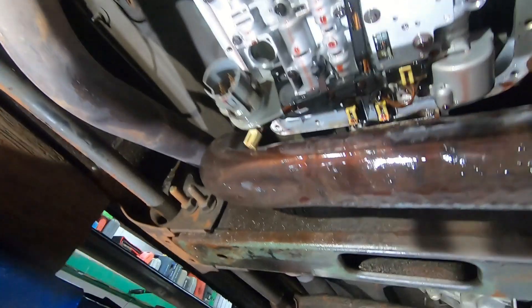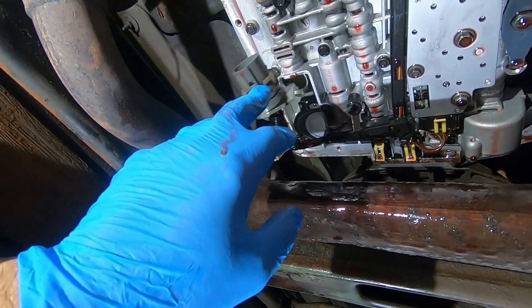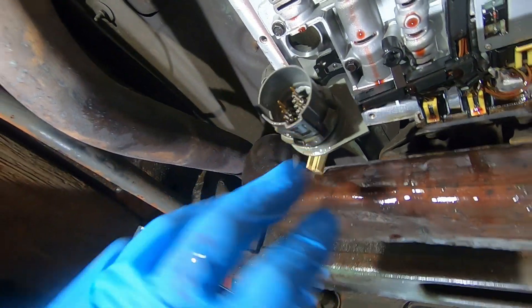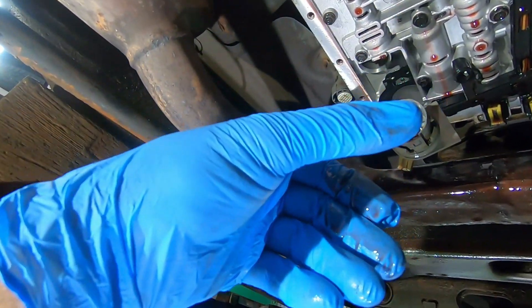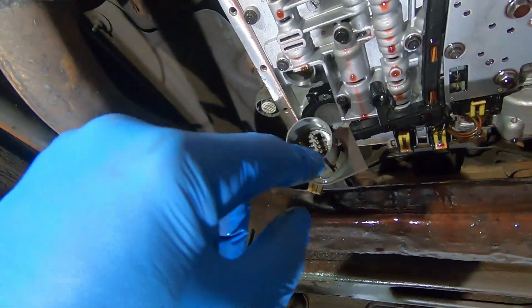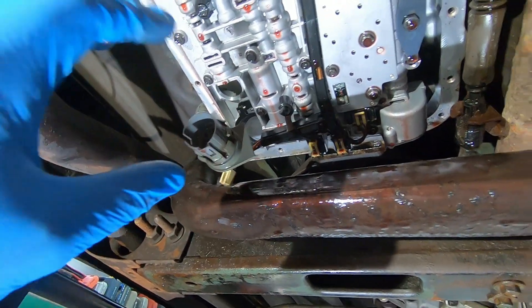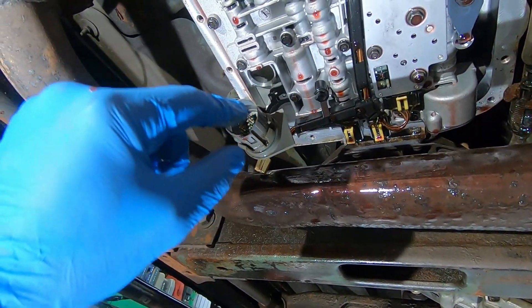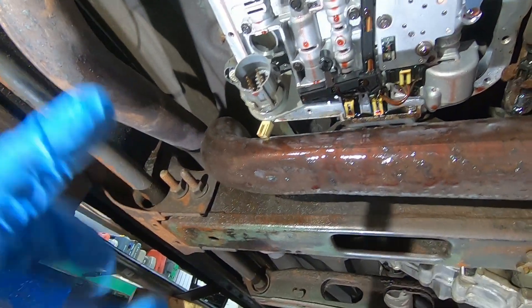I think the O-ring in my vehicle is tired, I don't trust that the tabs are full length anymore — they may have been worn down — and the connector doesn't seat fully up into the case. I also don't trust the existing inner seal. So what I'm going to do is change the O-ring and put some RTV sealant in the base of that seal.